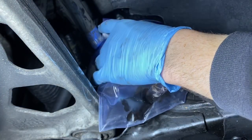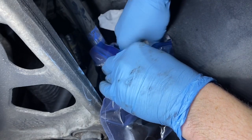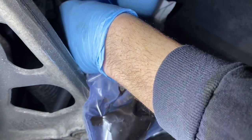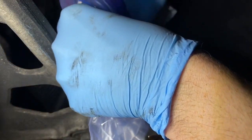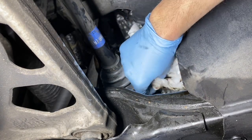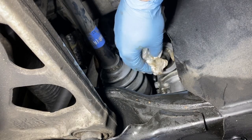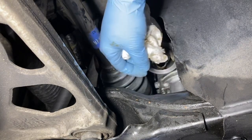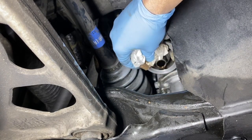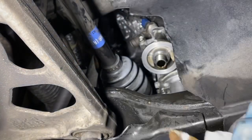It's been a couple minutes. I'm just going to pull the bag down now. First I'm going to stick a paper towel on the oil filter housing here and clean up some initial spilling. I'm just pulling this down now and wiping up the filter assembly with a rag. I basically just did this oil filter with no spillage — nothing spilled at all, which is awesome. I've seen videos with people laying aluminum foil down here to funnel oil off. But if you let oil drip down on the control arm and frame assembly, you're going to have oil drips on your driveway and garage for weeks. The bag method is great to avoid that.